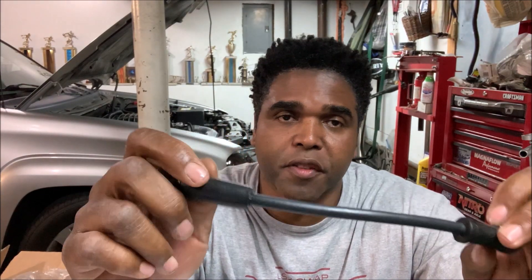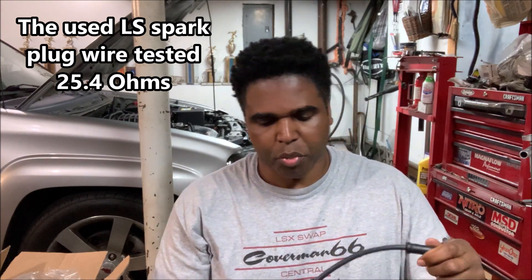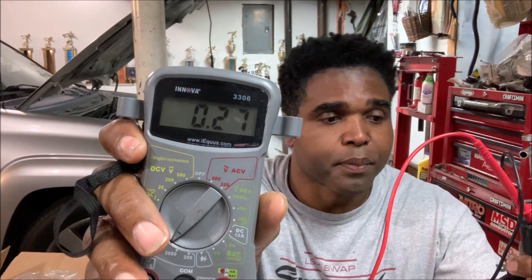Move the boot into position and that's pretty much it — but we've got one last thing to do: test the resistance. A spark plug wire is typically 40 to 50 ohms per foot, so let's see where we stand. I put one end of the ohm meter here and the other end here. This wire is five to seven inches and I'm reading 27 ohms, so I feel confident there are no breaks and I'm going to go install this spark plug wire.